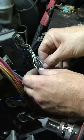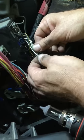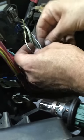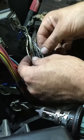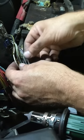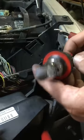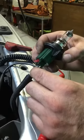Now this is an 06 again. I have a white wire with a tan stripe right here — that is the driver for the right side low beam. And I have a white wire with a blue stripe here — this is the low side driver for the left side. What you can do, if you wanted to go a slightly harder way — it's not too much harder and will only take a little bit of time — you take the driver wire, which is the white with blue stripe, and splice in right here on the back side.